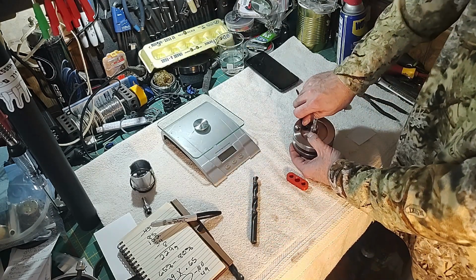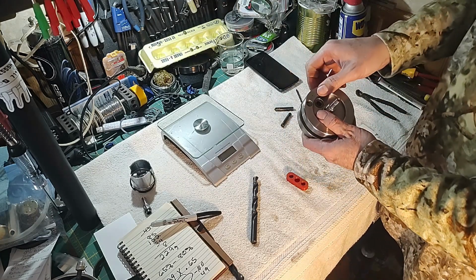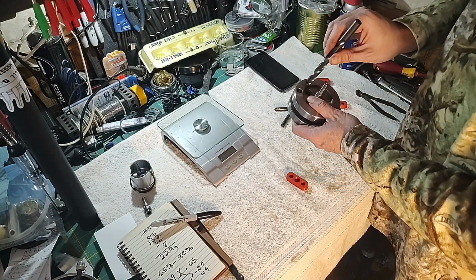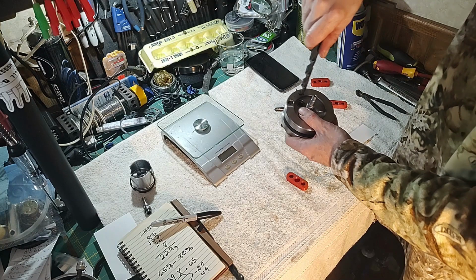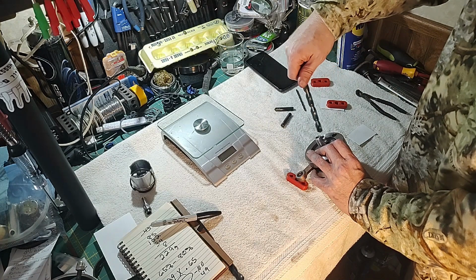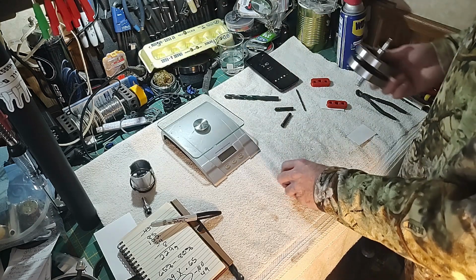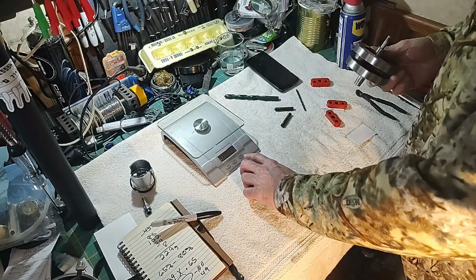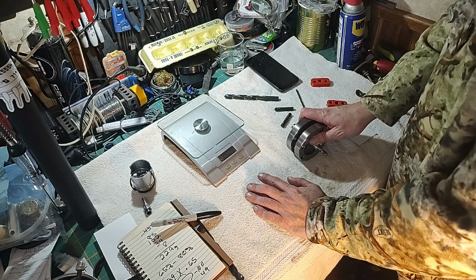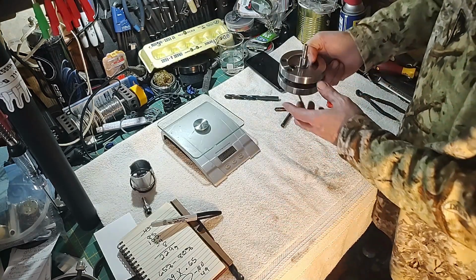Also looking at these, if we want to gain a little bit extra, we have these two holes here, and these are drilled smaller than I thought they were going to be, but we could enlarge those with the 1/2 inch bit, and that would give us an additional few grams. So I'll weigh it before, and if we can get 49 grams off of it or higher, then we're going to be much better off. Hopefully we can get 49 at least.